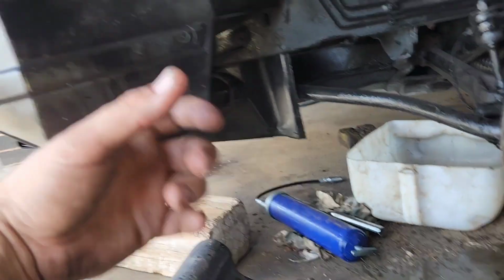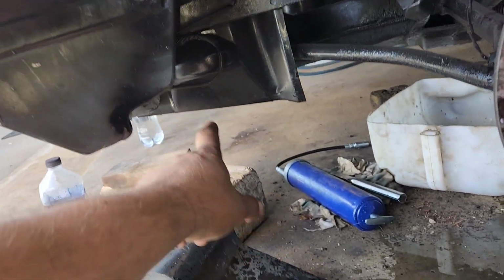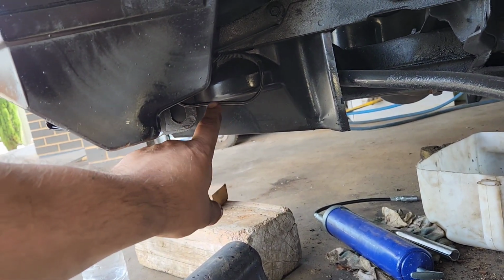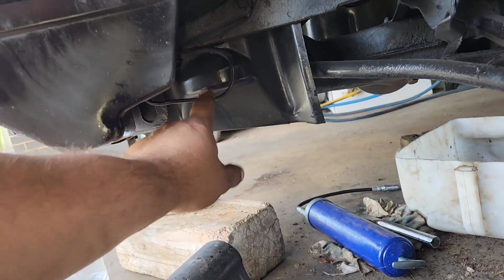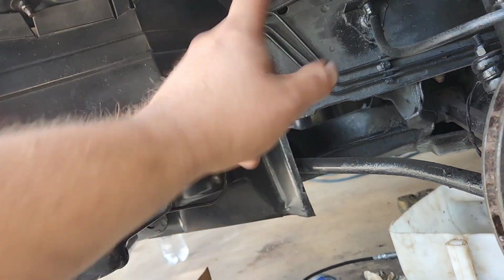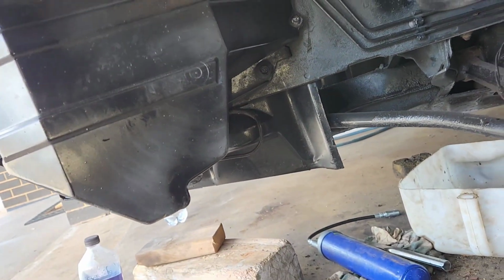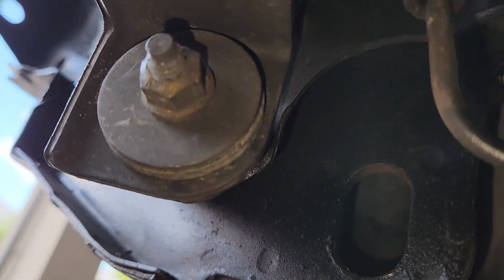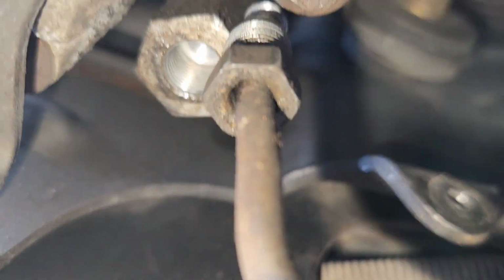So I'm just going to take the cover off the ABS unit and crack the line here and see if it's getting to the line at least. I know it's just blocked here. Then I can undo it both sides and maybe blow some air through again. Cars, mate. Yep, not getting fluid through the ABS unit. Where are we here? It's clean.